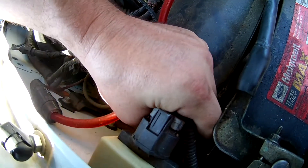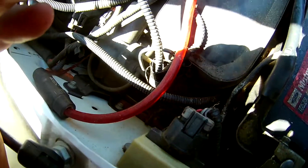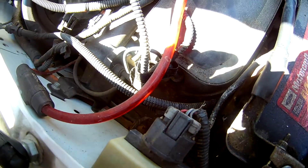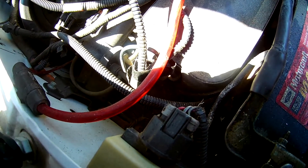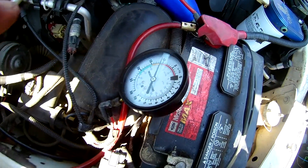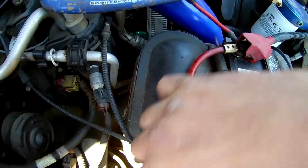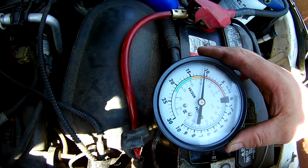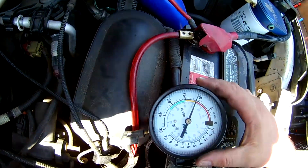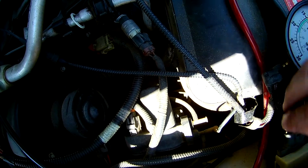So I'm going to pop that off and figure out what's up. I'm putting my vacuum gauge and plugging it into the actual vacuum source — disconnected from the solenoid. I can hear it — this is the source vacuum coming from this tank and this pump. I'm drawing about 11, so I know the source vacuum is okay. It's still holding vacuum with the solenoid disconnected. So that means I don't have any leaks all the way to the AC system — that's fine.